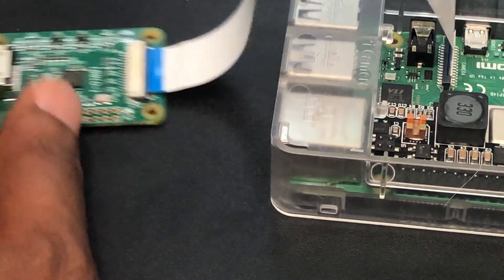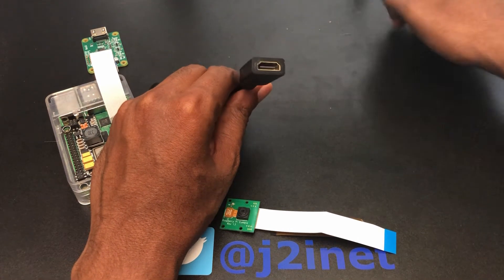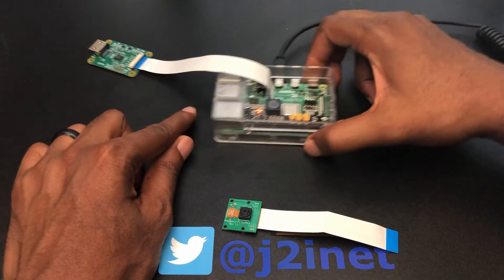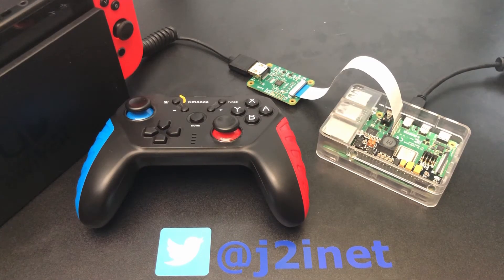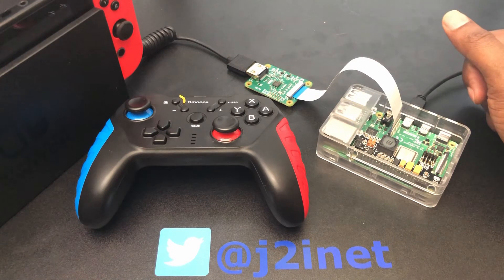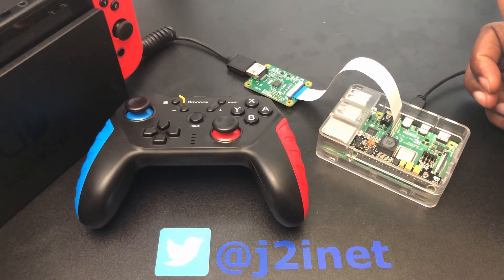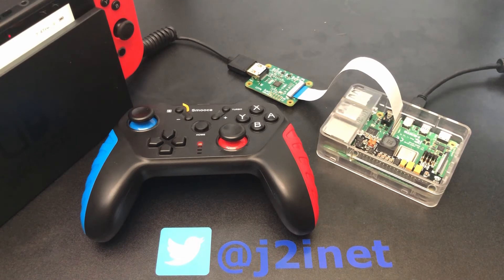To use it, you need to connect it to an HDMI source. Instead of connecting my Raspberry Pi to a monitor, I'm going to connect to a capture device on my computer so I can record everything the Raspberry Pi outputs. I'm using my Nintendo Switch as the sample source, going from the Switch to the HDMI capture device and then to the Raspberry Pi. Make sure your HDMI source is turned on — if it isn't, capture utilities will return an error that gives no helpful hint; it just suggests your camera might be broken or a driver isn't installed, when really you just need to wake up a sleeping device.